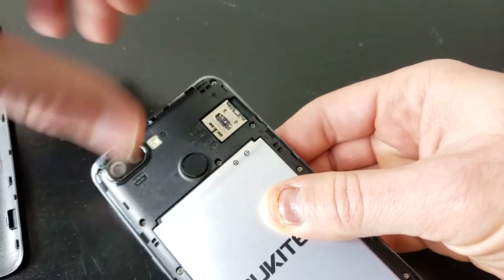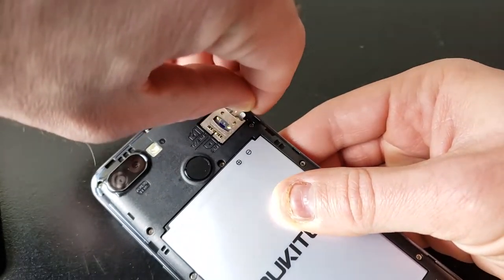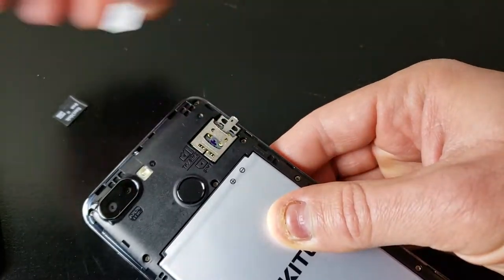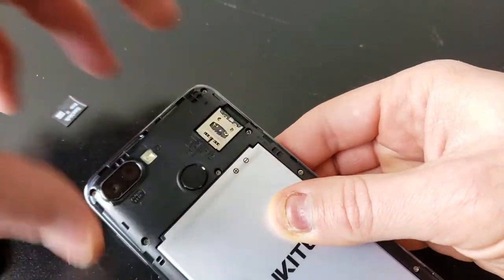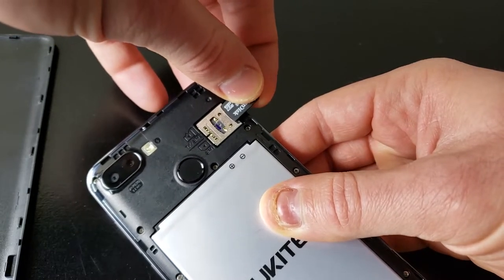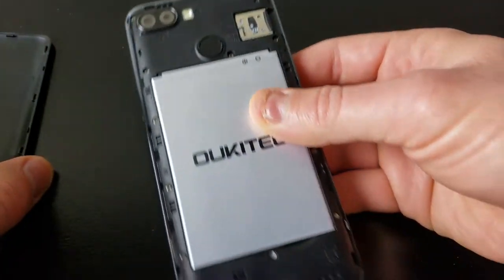The visible SIM card slot can hold an SD card or a SIM card, but where do you put the other SIM? You slide it right underneath the visible slot. When I did this the first time I thought I'd lost my SIM card, but if you look closely there's a little metal tab you can pull to remove it. The top tray fits another SIM card or an SD card, and the SD card can be used to expand internal storage once you format it, or used as portable SD card storage.